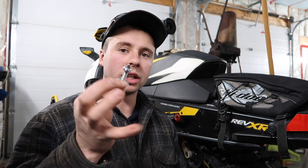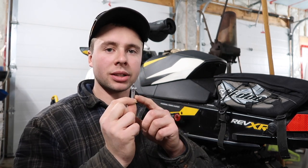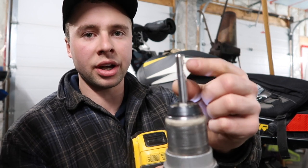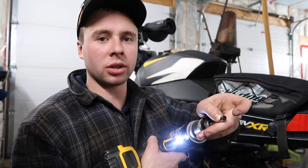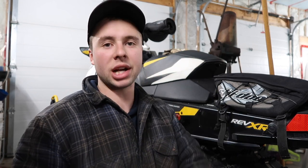So today we're gonna be studding the track. We ordered studs, nylock nuts, and backers. I also ordered this special tool, which I recommend getting. It's a hollow tool, cut out on one side, and it self-ejects the rubber plug when you drill. It keeps you centered and you can just pop right through the track — for the price of ten dollars, you can't beat it.